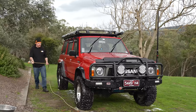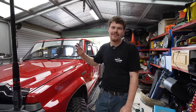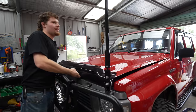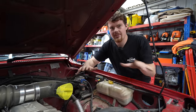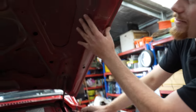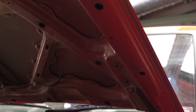There's a couple of reasons. The car's clearly not built as a comp truck — it's built to be a sort of neat car, a bit of a tourer, nothing crazy. If it was satin black with cut guards and 37s, beadlocks, sure, I'd put twin 4 inch stainless on it. There's another reason often overlooked: when you cut a bonnet entry, this corner of the bonnet is your main structural framework. You've got a bonnet skin crimped over onto this pressed tube, and the hinge bolts right next to it.